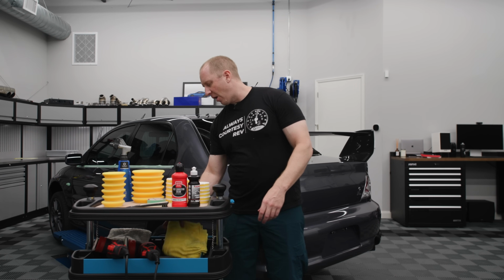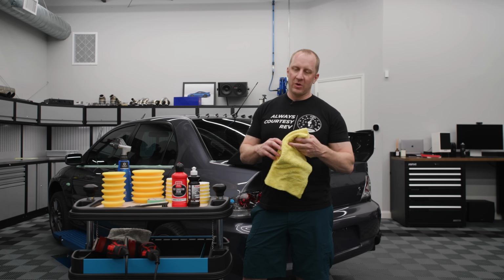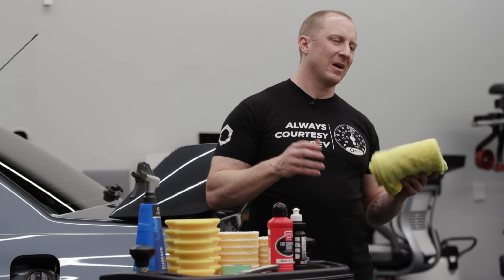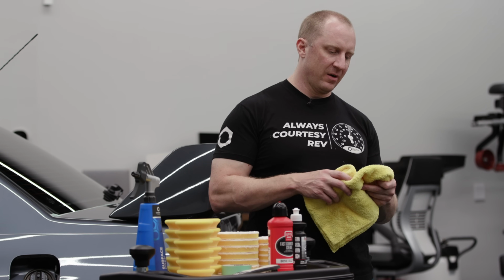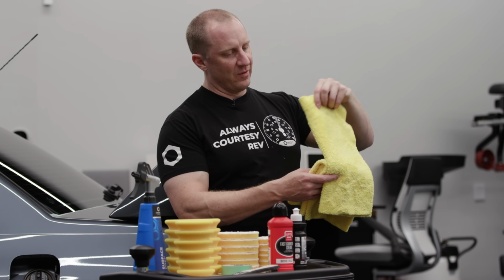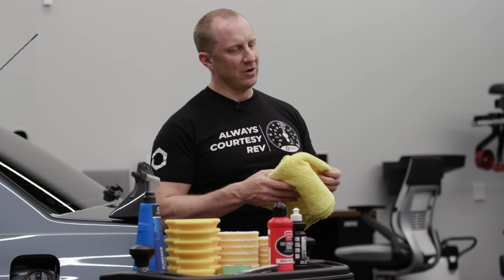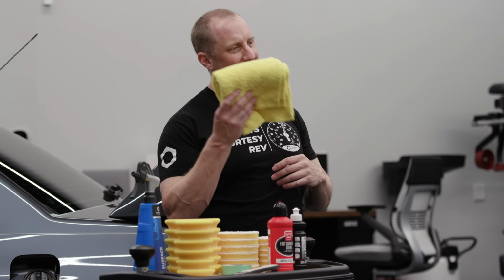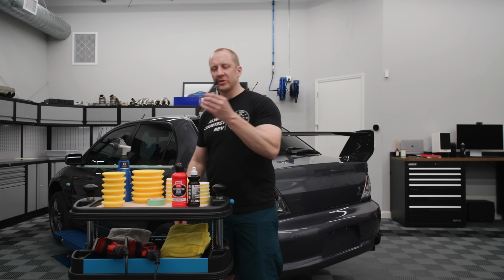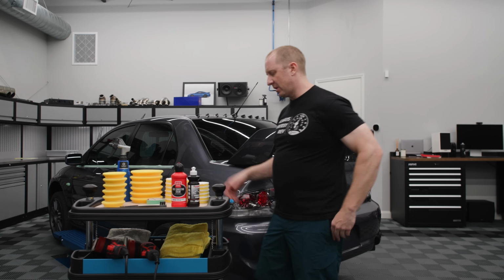The other thing that you need are towels. I like to have low pile and high pile towels, but for the purposes of this, you can always get everything done with a high pile. Sometimes the low pile can mar the surface depending on what kind of paint you have. But this is a 350 GSM towel from the rag company called the Edgeless 350. When you get into the real heavy ones, like the 400, 500 GSM ones, you don't gain anything from it. And so I think that this is the appropriate towel, and I think you want about 10 of these. So we have 10 in our package. And then the last thing you have is the caw tool, which is our applicator and our scrubber. So let's get into polishing, and I'll talk to you about what needs to be done here.